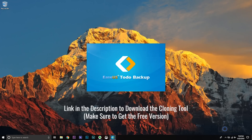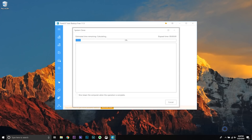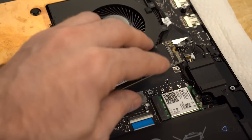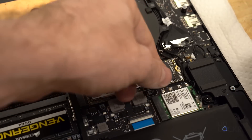If you are planning to upgrade both SSD slots, you will also need one more thing: a free SSD cloning tool. You'll only need this if you plan to replace the pre-installed 512GB SSD. We're going to use it to copy everything on that drive, including Windows, onto your new SSD that we'll then replace it with. This way, we don't have to worry about backups, losing Windows, or any of that — it just makes it a lot easier.